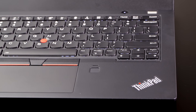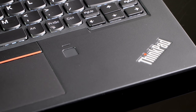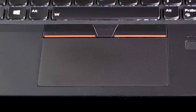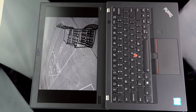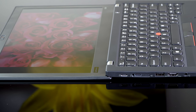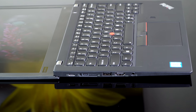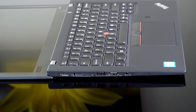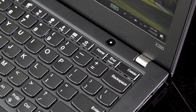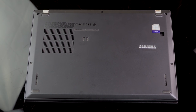You've got U-Series ultrabooks with 15-watt Kaby Lake R eighth-generation CPUs — Core i5 and Core i7, including vPro supported. RAM is soldered on board; there is no RAM slot. There's a single M.2 SSD bay and no hard drive bay anymore. Ethernet is supported via a dongle adapter that Lenovo offers, sold separately. The Ethernet chip is actually built into the laptop — it's just that the interface isn't there, so you need the little dongle adapter to plug in your RJ45.